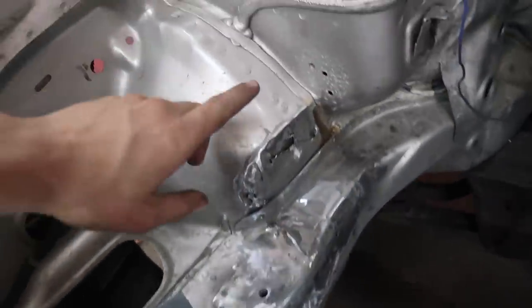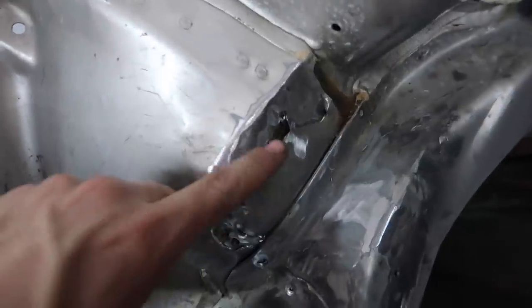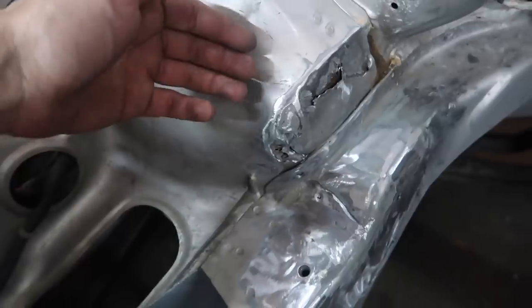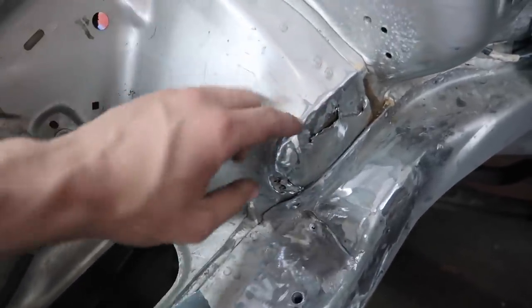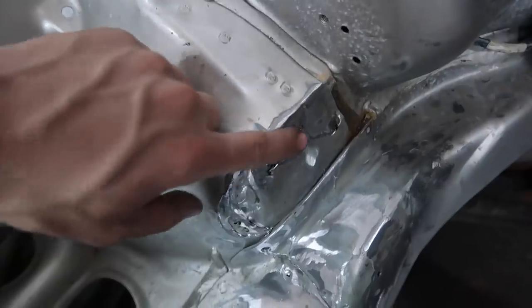around that. And then when we went to take the factory mount off right here, the air hammer chewed up some holes into the side of the sheet metal right here and there, and I actually used a hammer and pounded this all back out into shape from the inside of the wheel well, because this was all kind of caved in. But now it actually has the original shape. But we did poke a couple good holes in there.